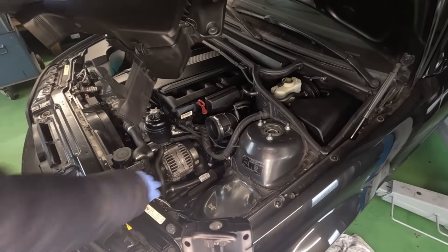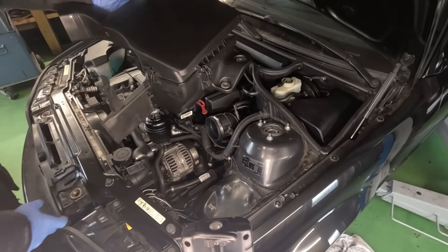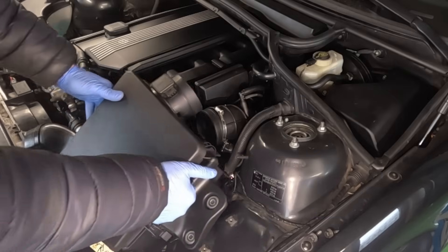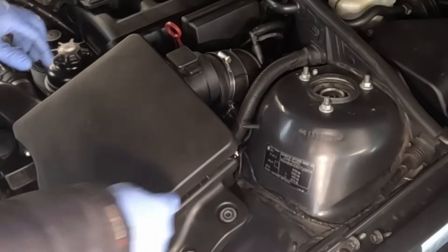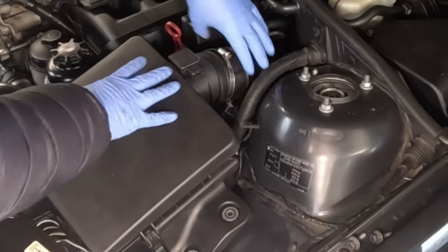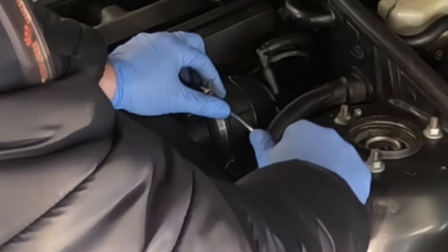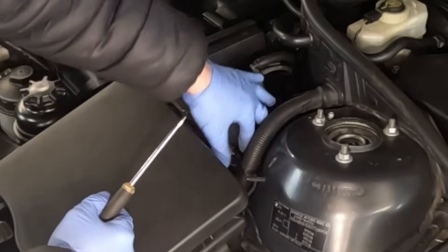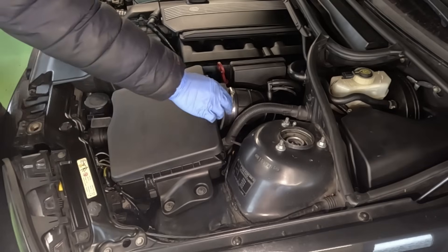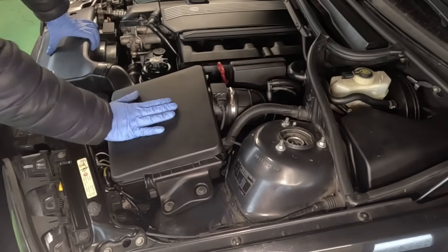And the OE install is honestly super simple. You simply slide it in kind of like this, so that this one here sits between the headlight and the radiator. There — now I hit the alignment rubber piece down there, then I should be able to just push it down here. Push this over and then just tighten it until it seems like it's enough — it doesn't really have to be tightened all that much. Then we can hook up the MAF sensor again. Now it's all installed, it's bolted down, MAF is hooked up, clamp is tightened and the bundle of wires is in place. Now it's ready for a test.